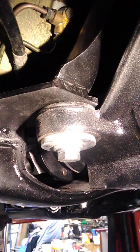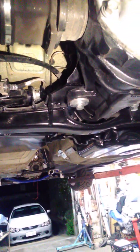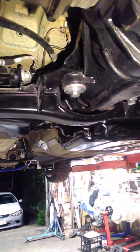I'll put a spacer in between the diff ear and the K-frame and that's it. There's only two bolts that hold this diff in at the front and two bolts at the rear. This is the Brintec kit. I'll have a play and see where we can get it sitting, and then work out whether to put the back of the diff down or leave the back of the diff up. I'm probably going to leave the back of the diff up and get a half decent pinion angle on it, because pinion angle also matters.